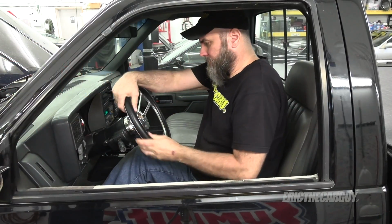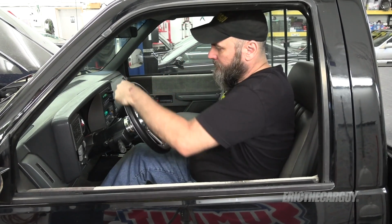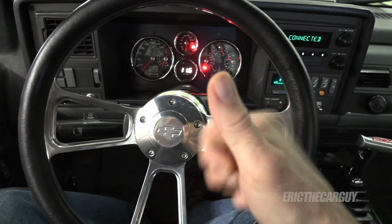I have a little problem with the truck that has sort of been there ever since I completed my rebuild, and I'm finally to a point where I'm getting to it. After driving for a while, my power steering goes away. In fact, it's almost non-existent. Say I drive on the highway for a little bit and then I try to steer the wheel. Afterward, it's warmed up and it's very difficult, if not impossible, to steer. However, when you first start the truck up, power steering works fine.